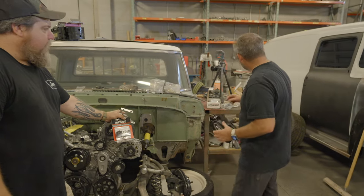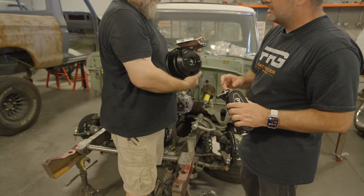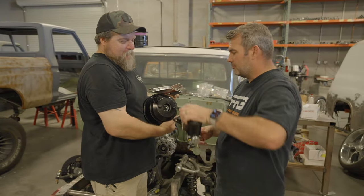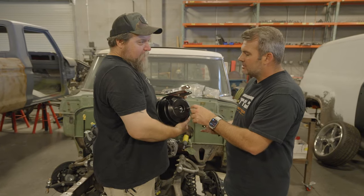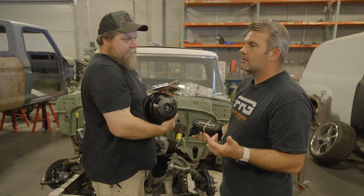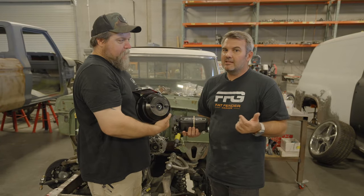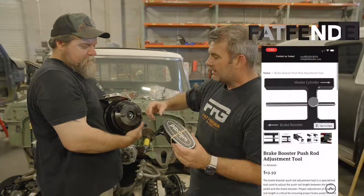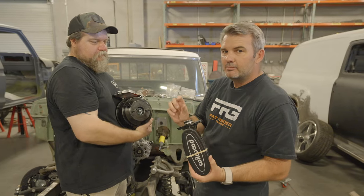Once you have that pin in there and the booster installed, this gap between the master cylinder and that pin is very important. Most people don't even check it — they just put it on. There needs to be about a 10 to 15 thousandths gap between the two. You can't get your hand in there and measure that, so there's a brake adapter tool that helps you measure this and calculate the gaps — it predetermines that for you.